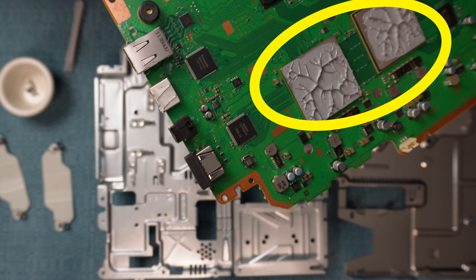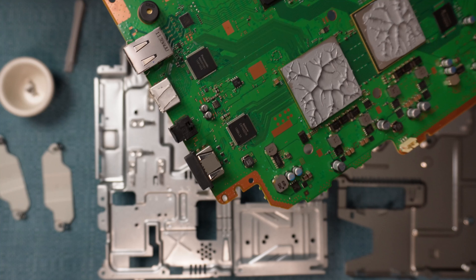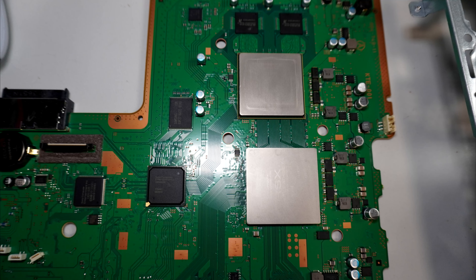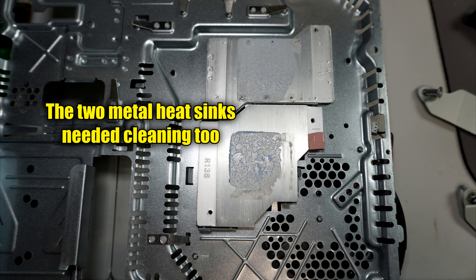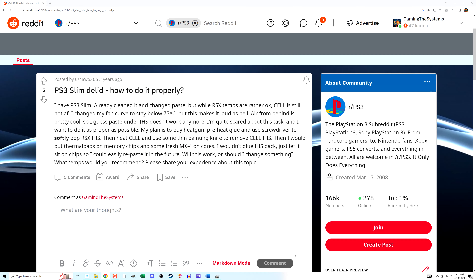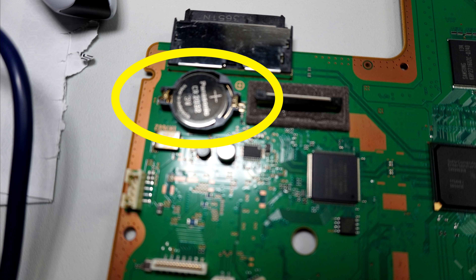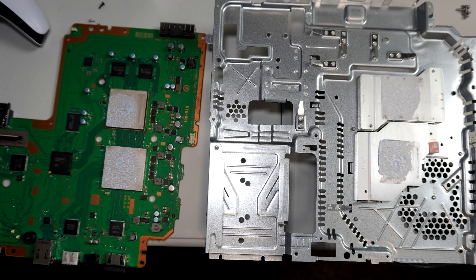There's the CPU and the GPU. Not long ago I replaced the existing thermal paste, so what you're seeing is the result of that work. Here's what the original paste looked like — it was still liquidy but it didn't cover the entirety of the chip's surfaces. I cleaned it off and replaced it, making sure it covered the entire surface. Some people go a step further and do a process called de-lidding — it's complex and risky, and the necessity of doing it on a PS3 Slim is up for debate; I won't be covering that here. If you're wanting to replace your battery, it's easy to do at this point — just pop the old one out and pop the new one in. This is also the best time to remove dust from all the various components.